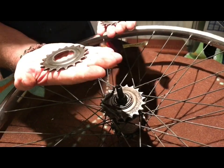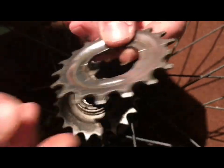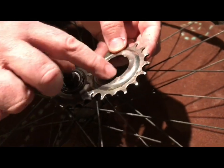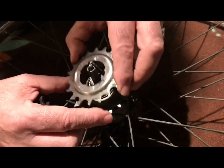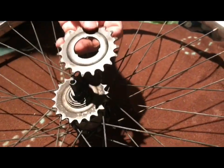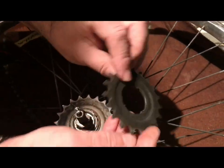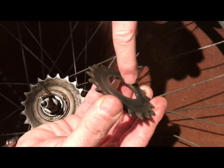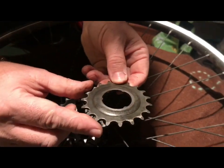Here's a proviso from experience. This is the Shimano type you'll often see - it's stamped out of thin metal. These are made of basically what I call 'chinesium,' an alloy of chocolate and cheese as far as I'm concerned. They're useless - it's not so much the teeth, it's the drive splines that wear very quickly. If you've ever had a sprocket that turns around when you put pressure on it, it's these worn drive tabs. Instead, get the old-fashioned thick type - still stamped but good hardened thick steel. Compare the thickness and you can see the difference; that extra metal is what stops the tabs wearing.